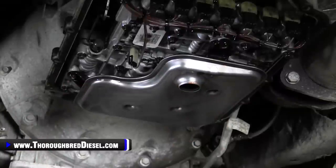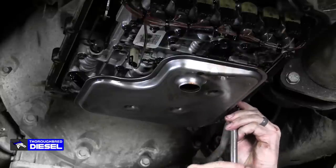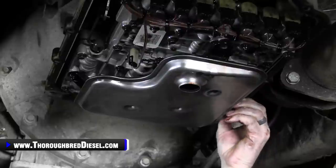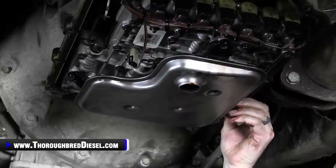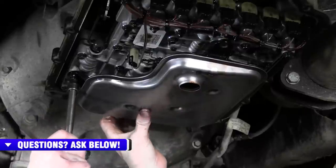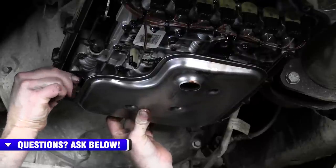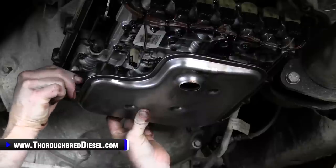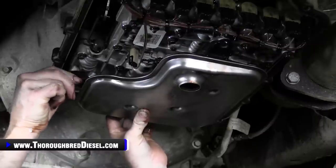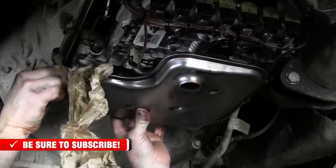With the other two, what I'll do, I will go ahead and pull one side. Like I said, again, you're going to get a bunch of fluid that's going to come out of here, even at this pace. All right. The two short bolts are on the sides of this, long bolt to the back. The actual inside of this filter, fluid out on the filter, I should say, has got a gasket, an O-ring on it, inside of the bore, going into the valve body. It'll hold the filter pretty well.